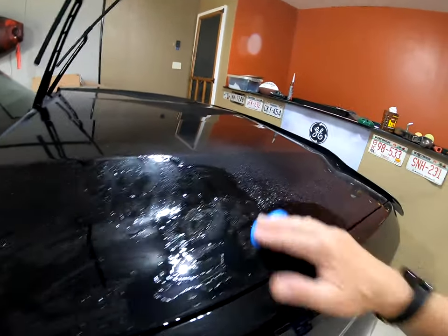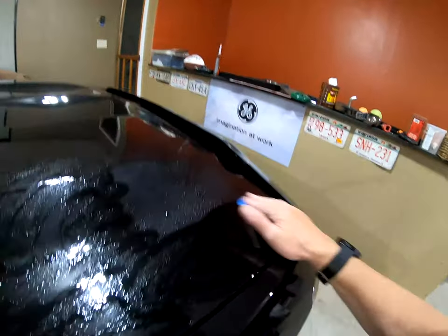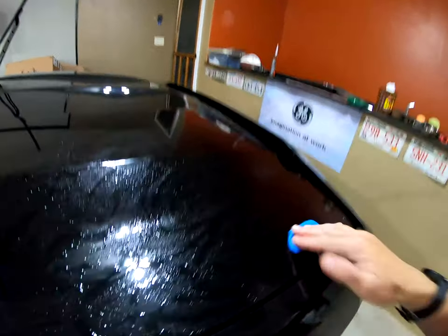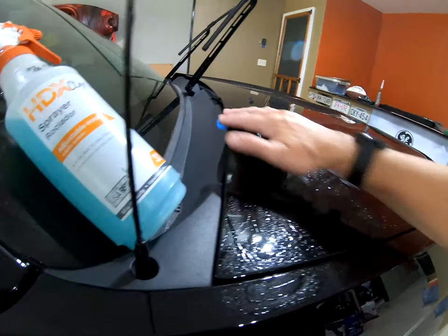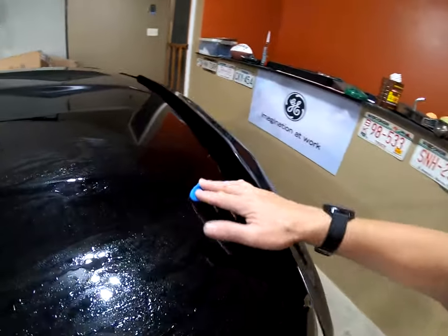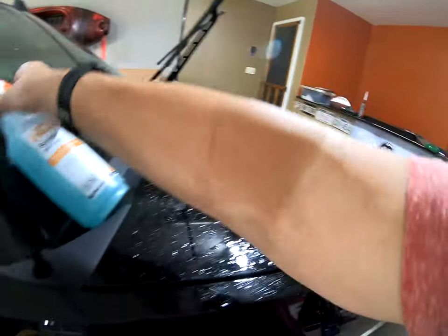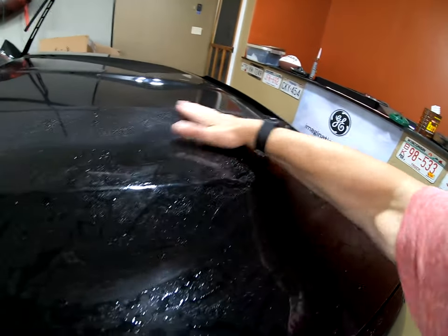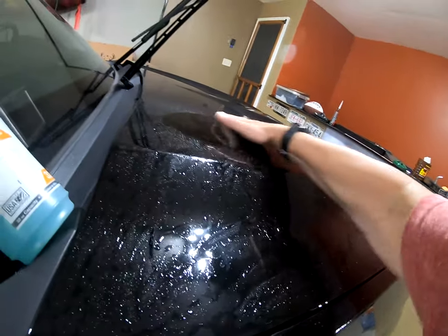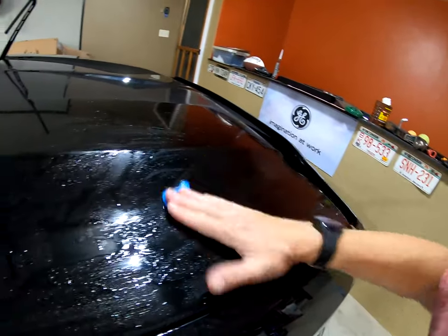The solution acts as a lubricant — it's a soap product — and I found this the most cost-effective. It'll pick up residue sitting on top here, like water spots from acid rain. I know there's tar on this vehicle a little bit, and I'll find it shortly. You can see this ain't too bad, but there are particles it's picked up. You just go through the whole hood, spray a little more on, then wipe it off. When you're done and drying it, the hood looks pretty clean. This is the prep work before I put a sealant or a ceramic coat on it. Then I'll look and see if there are any spots that need to be polished out — scratches and that.